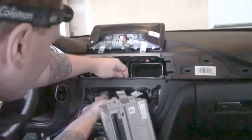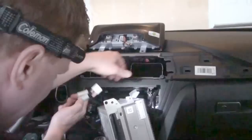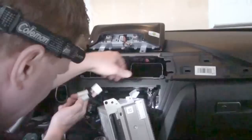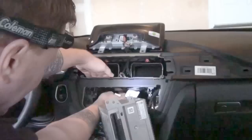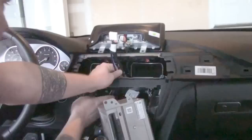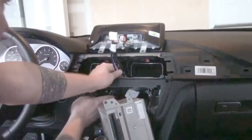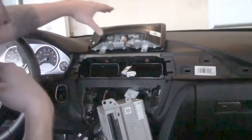While I still have the room to reach around back here, I'm going to do that first. There are a couple of openings directly underneath your vents — this is where you come between the opening in the frame back here and up through the vent. I'm going to pick the one on the left, just because it feels like there are fewer cables there to begin with. I'm going to take this and feed it back in and up through — slowly, carefully, don't ding up the wires. You want to make sure this is as neat and clean as possible. You'll also need to feed the cable through the hole in the upper section of the dash.